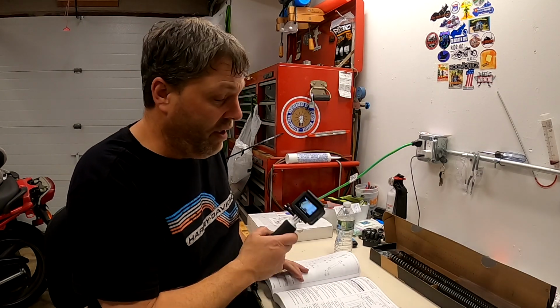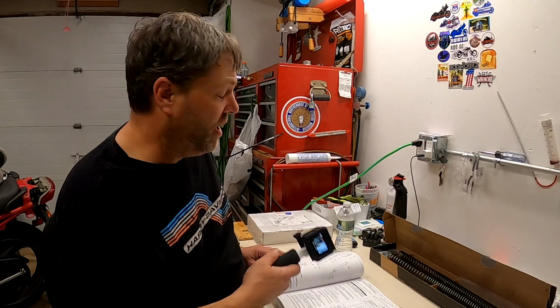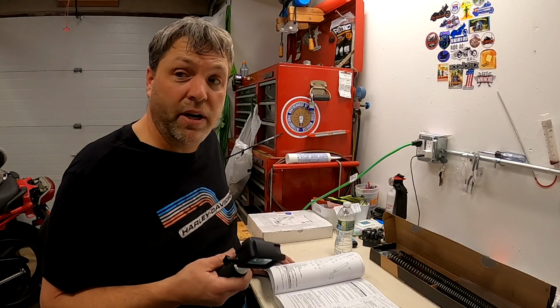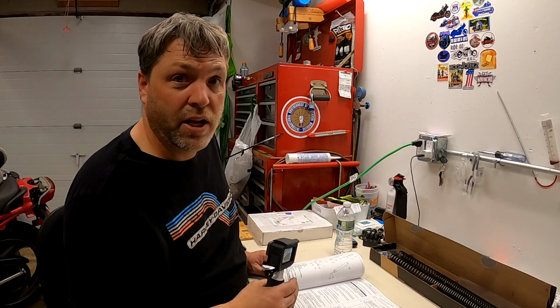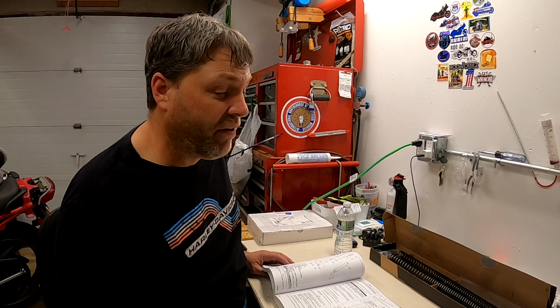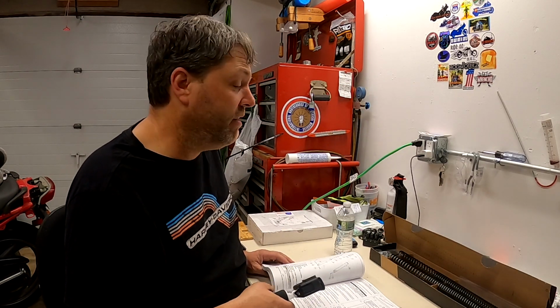But like I said earlier in the video, Harley fluid's good in the book for 50,000 miles. So if you're going to do your spring upgrade, just take the old springs out, take your measurement with your forks compressed to where it needs to be. You may need to add a little bit, depending if you're low or whatever. You may need to take a little out, but get it to where they tell you to have it, and you'll be all set.